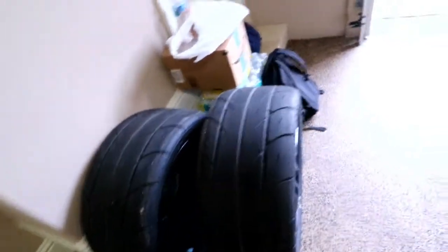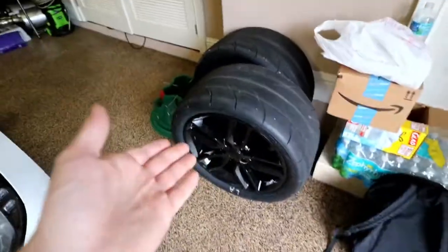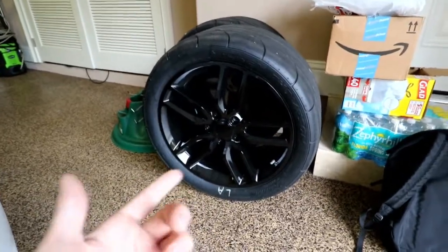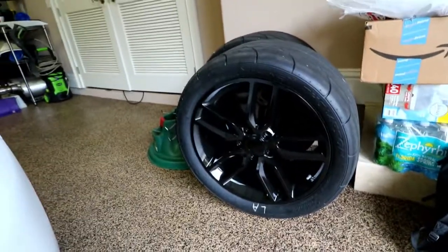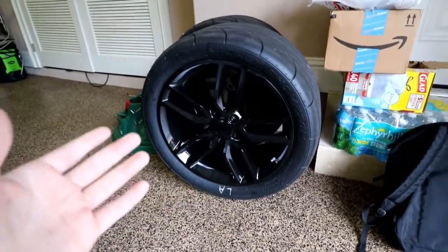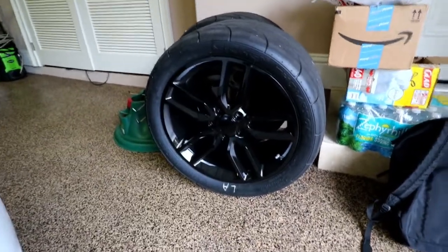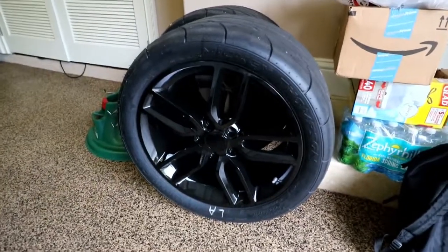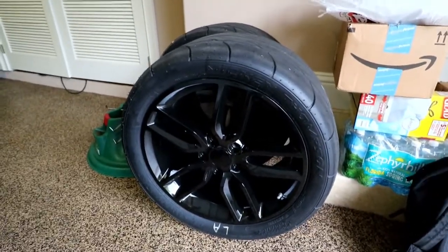Stock, this car comes with 285 rear tires, which isn't wide at all. I'd have you kind of go with a 305 street tire, even though radials are the better way to go. These are reproduction wheels from West Coast Corvette — they're 19 by 10 inches. The stock wheel on this car is 20 inches, so it's one inch smaller, but the width of the sidewall makes up for the loss of height. They have Mickey Thompson ET Street SS drag radials, and they are 305/35/19.